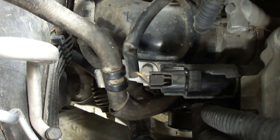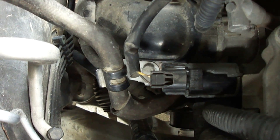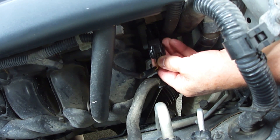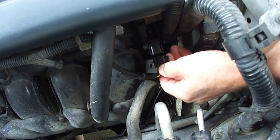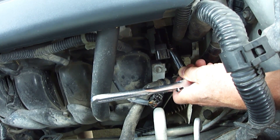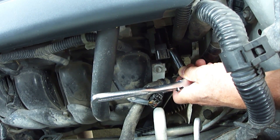I'm going to refer to this as an oil control valve during the rest of this video. Once you locate your oil control valve, the first thing you'll need to do is disconnect the electrical connection on it. Next you'll need to remove any bolts holding the oil control valve in place — there's usually just one.